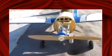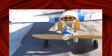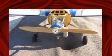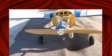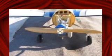I just gently pulled the ring off and took a jeweler's screwdriver, tried to be really careful not to scratch the sides of the cylinder, and went into the slot and cleaned out all the carbon. Then I took a piece of Scotch-Brite to the top of the piston and cleaned that off. I did not touch the cylinder, so there's still a lot of carbon sitting at the top, but it seems to run great like that.